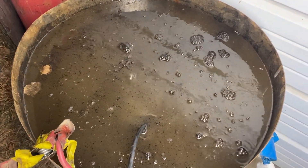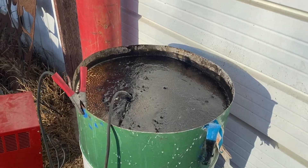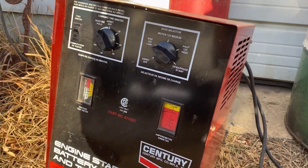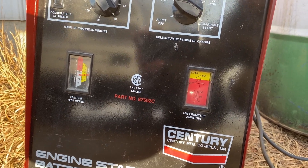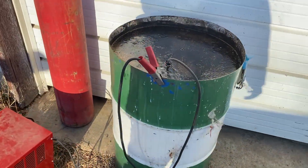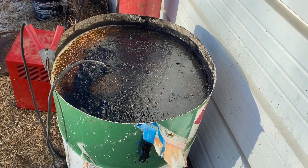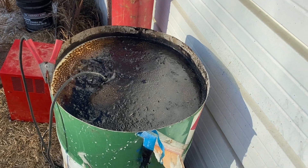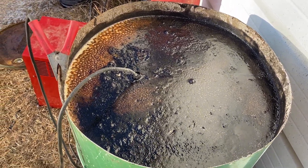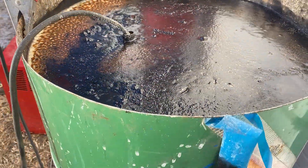Make sure you kind of experiment with stuff like that. Now I think it's actually cleaning the block. We're sitting at about 16 to 20 hours in. This other charger I picked up off my buddy Brad Ward does 12 volt 2 amp, but reading the voltage and ammeter it's doing like 6 volts and 45 amps. I don't know if it's how the charger works or maybe a side effect of having the steel barrel — it's just really conductive. You can see quite the film over top, which I think might be rust possibly, and quite the oily film.